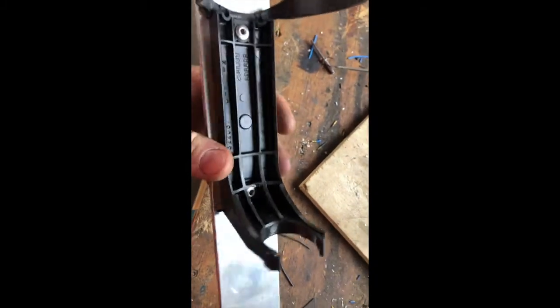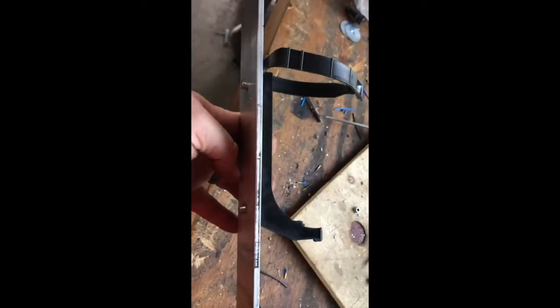And let's take this out of the vise. Take our spacer out, and you can see down there, we got a nice flush set, and the rivet pulled very nicely. So now we're ready to basically go in and install this. Shouldn't be too much to it. Just cover a couple more details that I did.